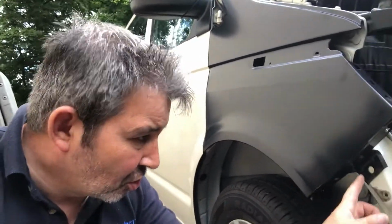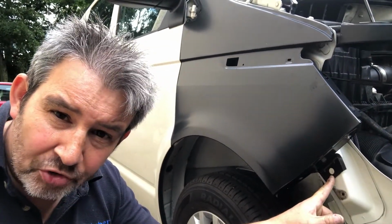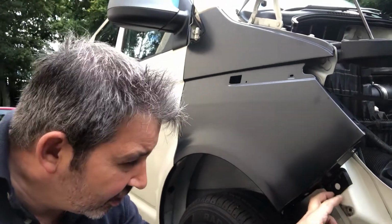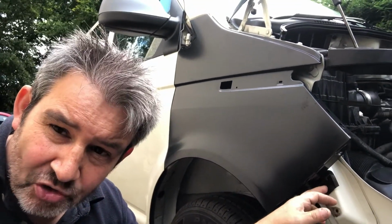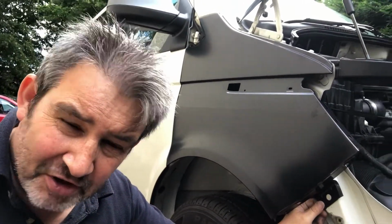With all of the panels now fitted and the screws tightened, we can now look at the last remaining issue, which is, as we mentioned earlier, the fact that there's a difference between the 2 holes in the front of the panel. So what I'm now going to do is to mark and drill a hole here. I'm going to put in a riv nut and use a bolt just to secure it. You can see that's why I've left this one to last.